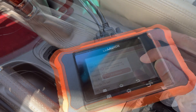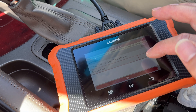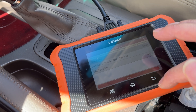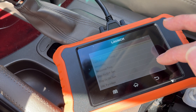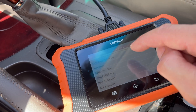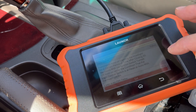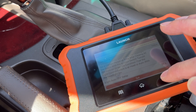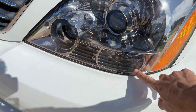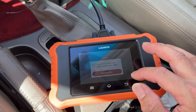Light control - so for light control, these are just the various settings. I'm going to turn off the DRLs on here so I don't burn out those bulbs, because that thing uses the turn signal bulbs. So we're going to turn that off - we don't need those things. Then we're going to do the display sensitivity. A lot of these settings might be in your nav menu also, but you can also do it here. This is the delay to turn off the light - it's 30 seconds when you walk away. So I turned off those DRLs. Some of you guys that don't like that thing being on all the time and burning out your headlights, that might be an option for you.